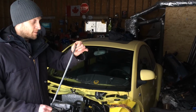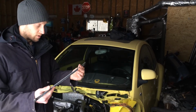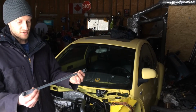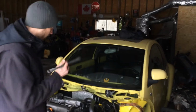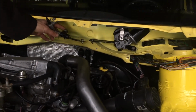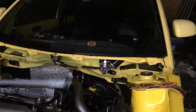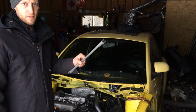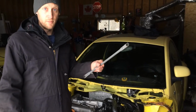All right, we have our wiper assembly arm from our donor car. We're going to cut a chunk out of the center of here, put a nut on one side, some threaded rod on the other, so we have a little bit of adjustment. And then we finally have our missing piece for the mono wiper, a uni-wipe. So this guy here will, yeah, we just need to connect these two. So take this chunk out. Any fine tuning we can do by just spinning a thread. So probably find some fine threaded rod and use that. And then on to actually making the wiper fit.